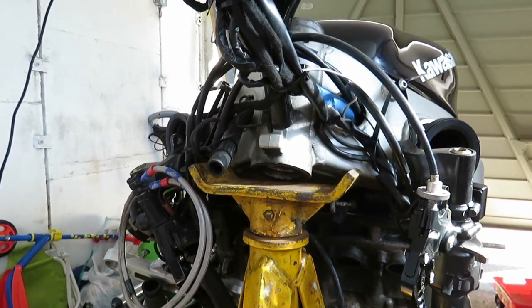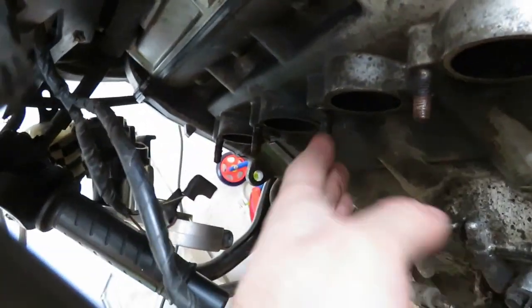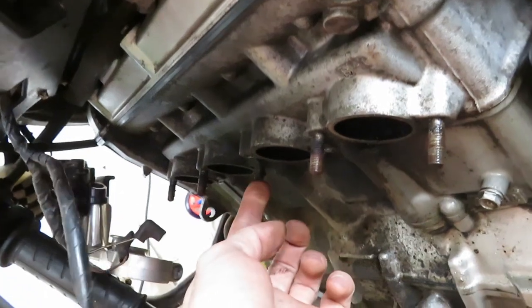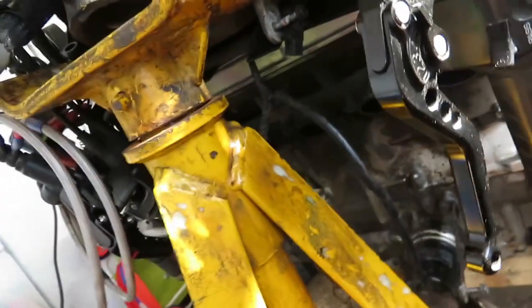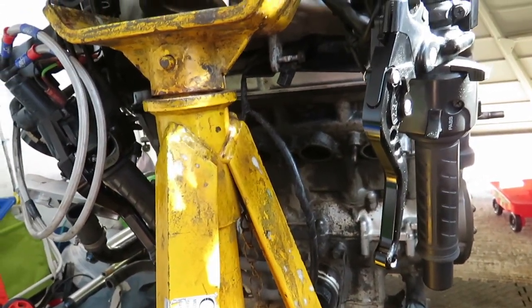And now what I'll do is wait till tomorrow to weld a nut onto this and try to get it off straight away, because all the heat will be transferred into the thread itself, and then should help me get it off. I'll clean it off a bit first to get a better weld. There's that breathing again.